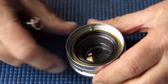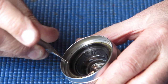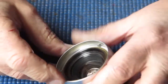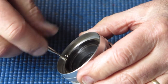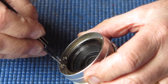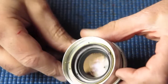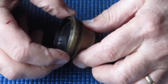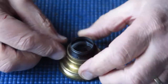Here we have the lens capsule in the mount. There are three screws here which adjust the infinity focus or the position of the focus helical on the focus scale ring. These screws show some damage, which suggests that someone's been poking at them with a bad screwdriver or just poor technique. So let's have those screws out. With the lens capsule out of the mount, you can check this focus helical and see if it's quite stiff - but it's not as stiff as the focus appeared to be. So that's part of the problem but not all of it.